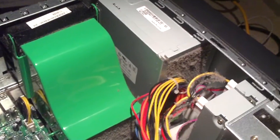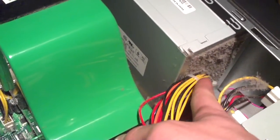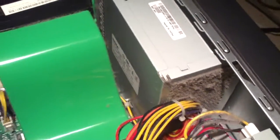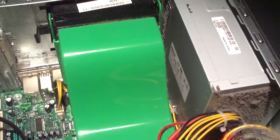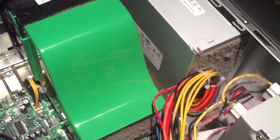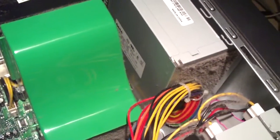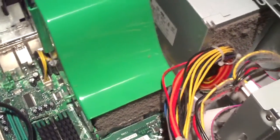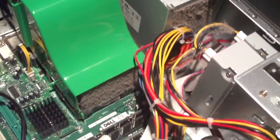Also, have a look here at the power supply. This intake vent on the power supply is slammed full of dust. Dust is a good insulating material — it insulates so well — but it will cause your computer to overheat and can cause many, many problems with your computer system. Sometimes irreversible problems without major repairs.